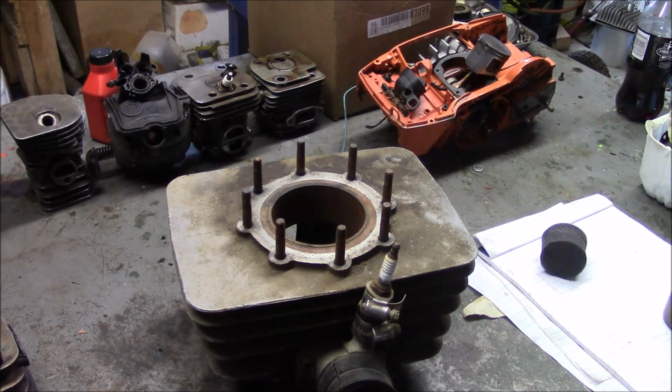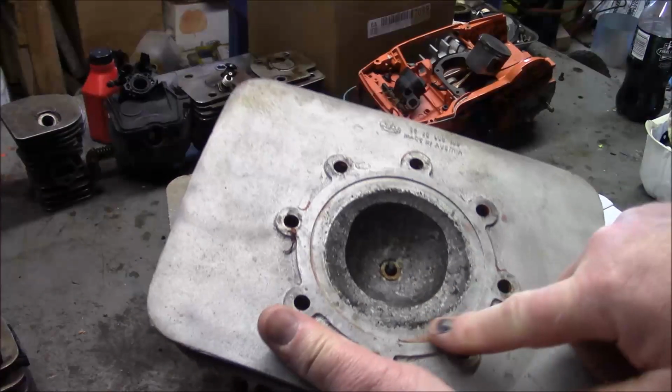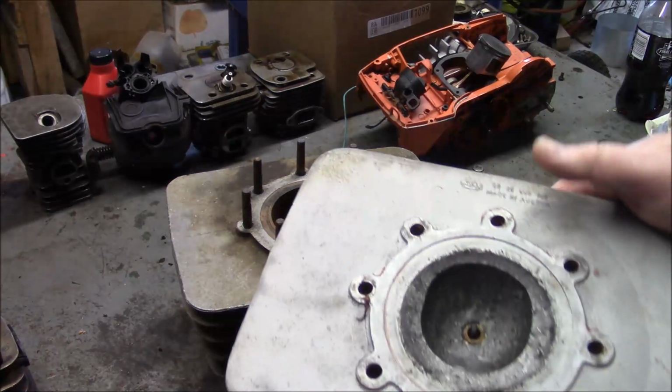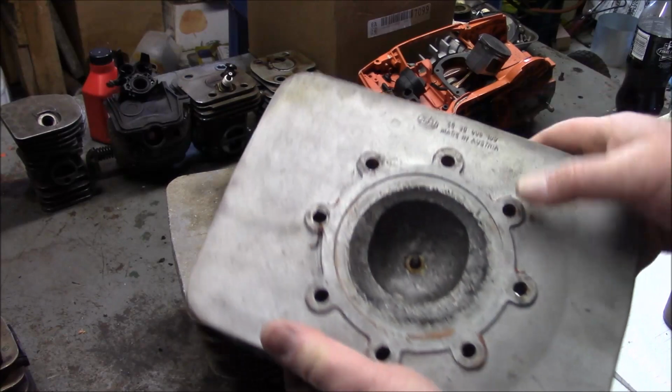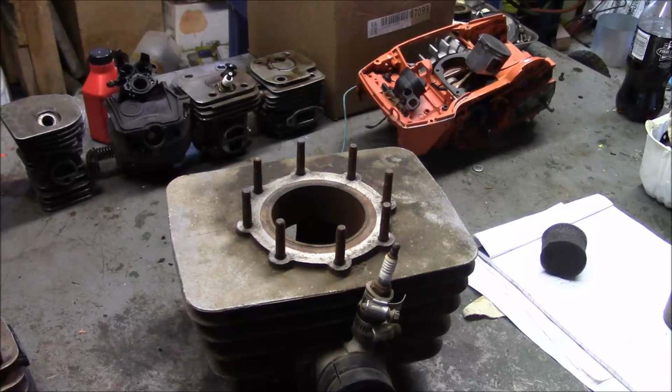The second thing is this, not to be a bit of a motorcycle snob, but the saw hot rod guys have been working their way towards this 1970s concept for a very long time. And you see the race saws where they have basically cut the top of the cylinder off to make room for a cylinder head. Well, this is what they use for inspiration, and the reason is when you cut the top off and make a separate cylinder head, then you can actually machine the shape that you want for your combustion chamber. And there's a lot of reasons why that makes sense.